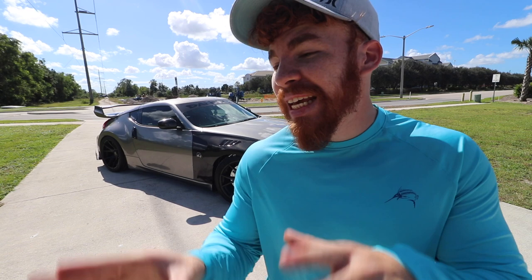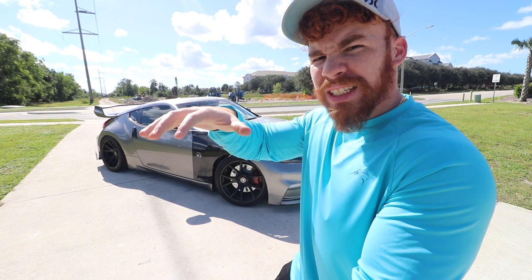We grabbed the wheel and pressed it against the lug nut, and then Alex slowly started taking it out with a socket, slowly, slowly. And I made sure I kept tension at all times, so the wheel was compressed against the stud and the lug nut, so it couldn't just wiggle around. And that's how we were able to take it out, thank God, because I've seen some videos on it.